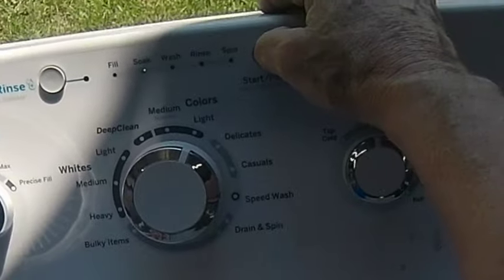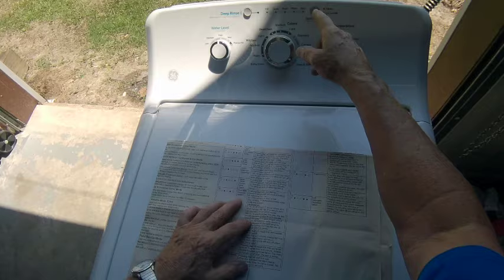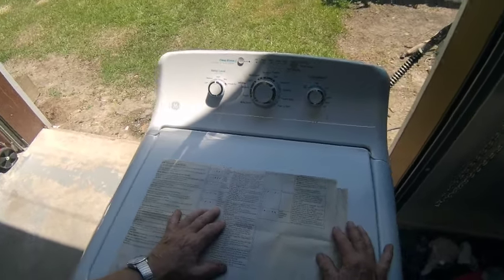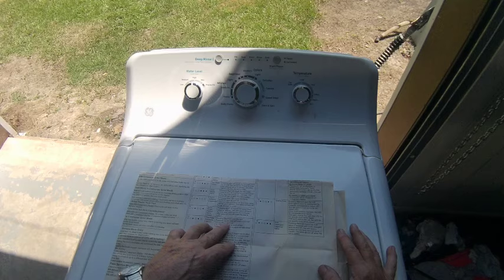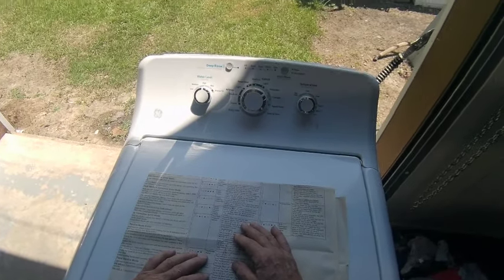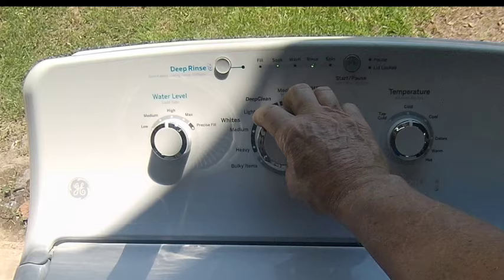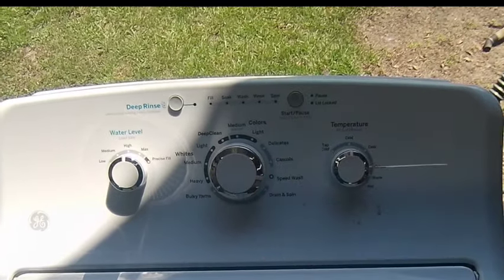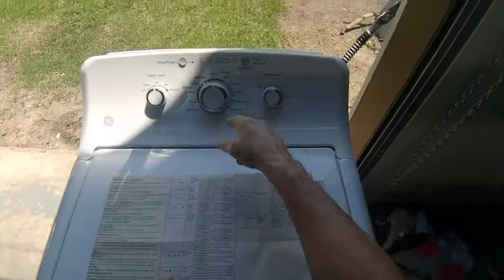Some of these features aren't on every machine — if you test it and it doesn't come on, this one does. And this is a spray rinse — it has that. Now the flow rate pressure sensor — it would depend on what's going on. You can do this test if you'd like, but it takes a while and I haven't seen too many problems caused by this. This one doesn't have a recirculation pump, so if you turn this on and push the button it does nothing. Turn it back off. The drain pump is these two — drain pump comes on and the line gets heavy.